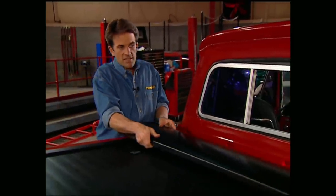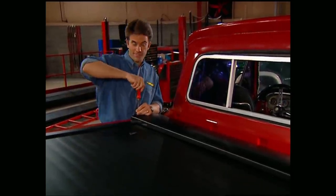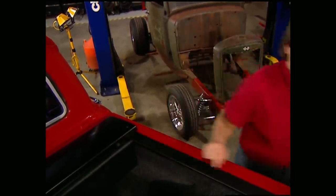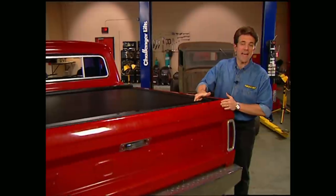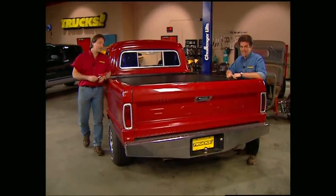While the cover is closed and Stace adjusts the fit to the tailgate, install the drain fittings in the bottom of the canister floor. Once those are in place, mount the plastic cover — it's easy to over-tighten these, so be careful, because if you crack it, you'll have to replace it. Water runoff is a factor with any tonneau cover. With the Pace Edwards cover, water runs down the sides and into the canister in front. Remember those drain holes in the bed floor? We cut through the bed rug and run the supplied hoses through the bottom of the bed up to the drain fittings, which will eliminate any small lakes in the bed. The cover is spring-loaded, making it really easy to open and close, and the low-profile look is really cool on our classic. There's no paint to scratch, either.